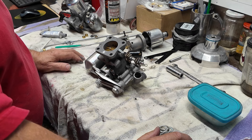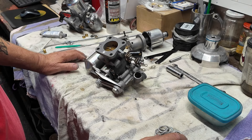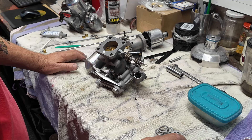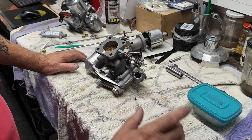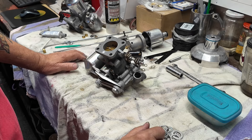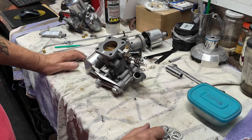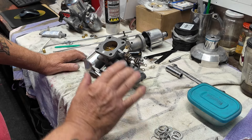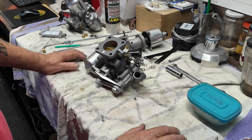Now it's a case of getting the carburettors put back together and then put them back onto the car one by one — that shouldn't take long because there's only two of them. The biggest problem is getting the nuts back on, but before I can do any of that I have to tighten the intake manifold nuts, because as you saw from my previous video that's where I think my leaks are coming from. So that's the next job and I'll be doing that while I let this set dry.